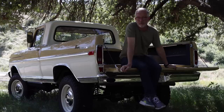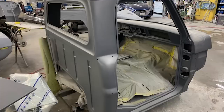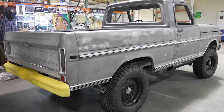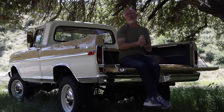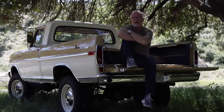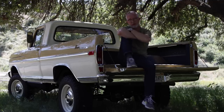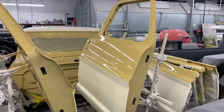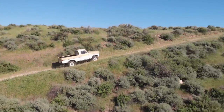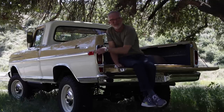Because these are so rust-prone — and we've done this also with the Icon Bronco program — we have now started powder-coating the raw bodies in white metal after we silica-blast them, so you get chemical and mechanical tooth. After all the heat-related bodywork is done and all welding torches have been put away, we hammer it out to hammer-dolly smooth, powder-coat it, send it back to the body shop. Then conventional surfacing block and fillers, then a full conventional prime, then a full sealer, then paint, then the other paint, then clear coat. It's a two-stage system that helps us get a beautiful transition between the white and cream sections without you being able to physically feel a line.